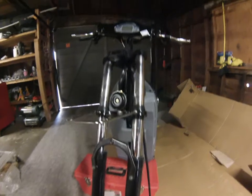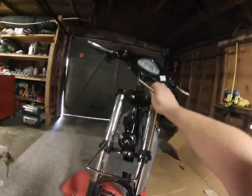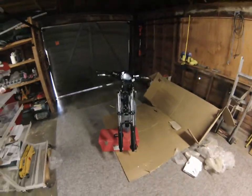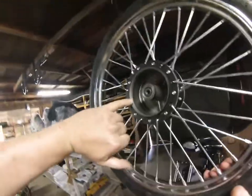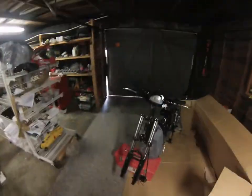Here are your fasteners for the front wheel. Now would be a good time to check for basic alignment and make sure the shock actually works — no fluid leaks, seals are good. Check the alignment of the bar; it seems pretty straight and didn't get whacked around too hard during shipping. Be sure to clean the inside of the wheel as they ship packed with shipping grease just to prevent rust while in storage, but that will make the brake shoes slip. You need to clean it out for good friction once you tighten and adjust the brakes.